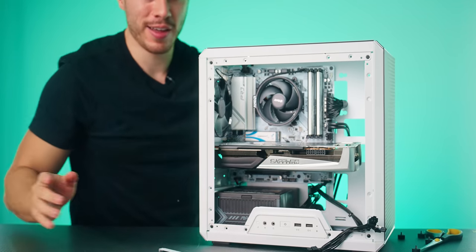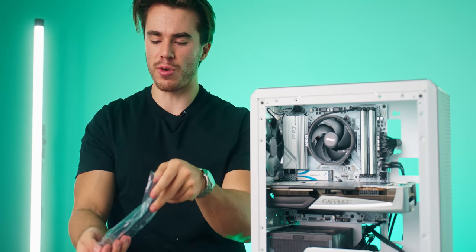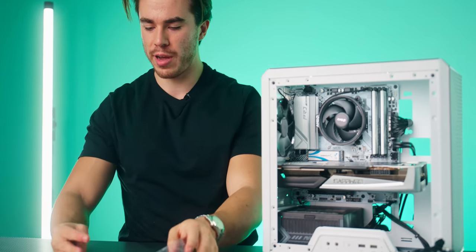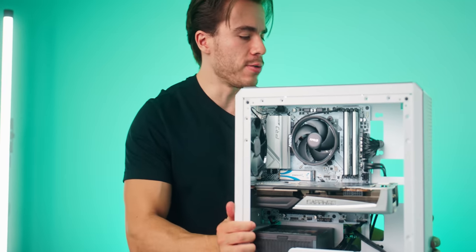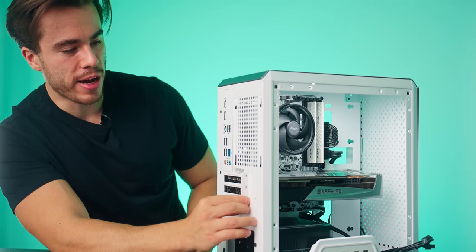Like that. And now, let's go ahead and return to our baggie full of screws right here. Let's pour this all out. The same screws that we used for the power supply and even the motherboard are the ones we're gonna use to screw in the 5700 XT into the PC case. But first, we gotta go ahead and put back on the PCI cover.